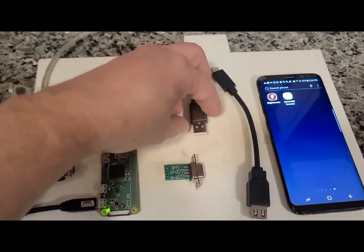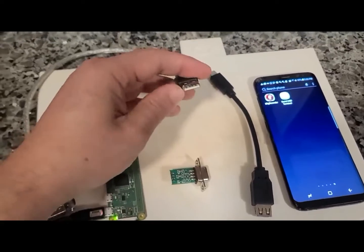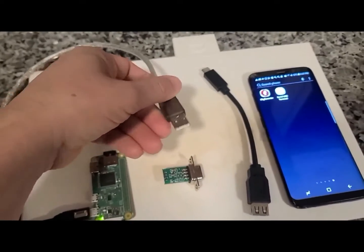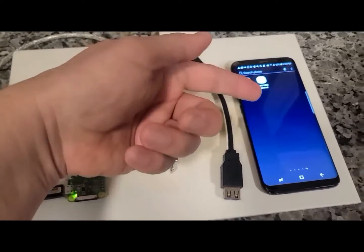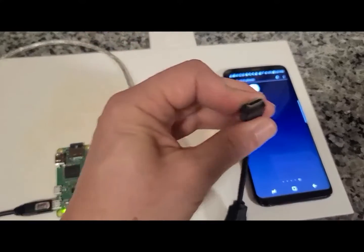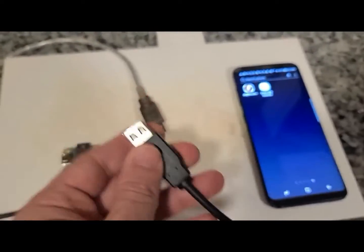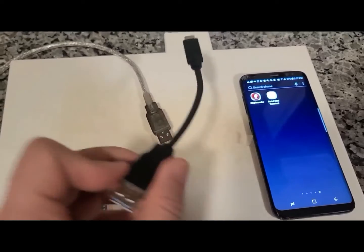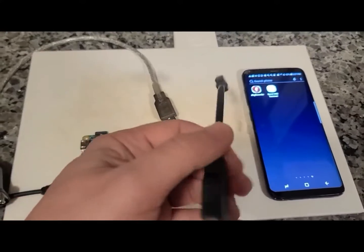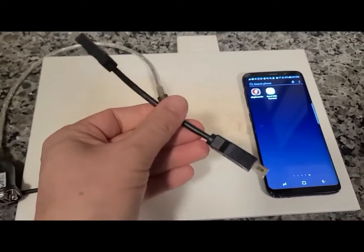Since the phone doesn't have a USB Type-A port, we need another adapter. This works fine on a laptop with a regular Type-A connector, but otherwise you need a different adapter. For newer phones, or even some laptops that now have USB-C, you can use something like this — it has a USB-C connector on one end and a USB Type-A female on the other. It's important that you use a cable that supports USB On-The-Go, sometimes known as USB OTG.